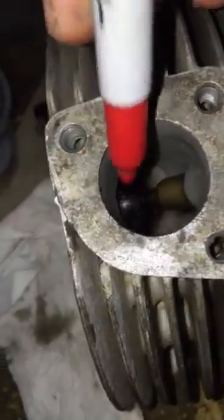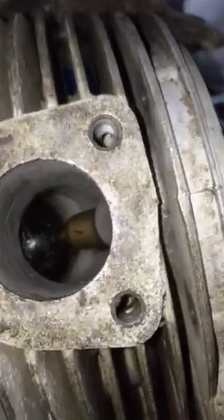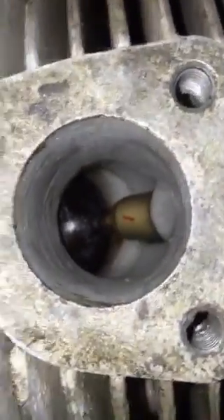I have a problem with my valve guide. I marked it so I can show you that it actually moves. I'm going to stick my finger in there and rotate it a little — as you can see, the mark moves. I can rotate it to many different positions; it rotates probably around 80 to 100 degrees.